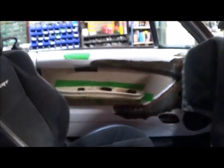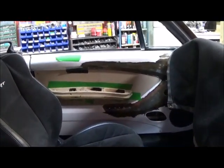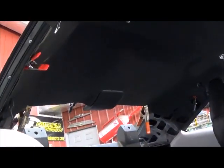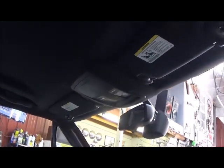I'll clean it all up and put glass on it — the other one has been setting for almost 24 hours, clamped, locked down, glued, screwed, and ready for glass prep. I've also got the headliner out of the Hellcat and I'm just gonna see how close it would fit — it fits extremely well, so I'm going with it. I've already got the visors in, they work and light up, the overhead light works, and everything about the headliner plugs right back into the factory wiring harness — including the camera to pick up oncoming lights and dim your lights. The windshield will also have automatic wipers to detect rain.